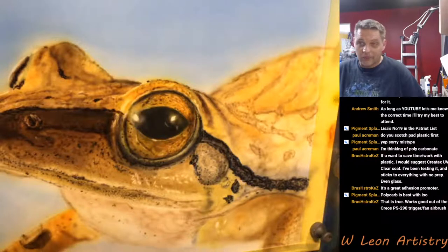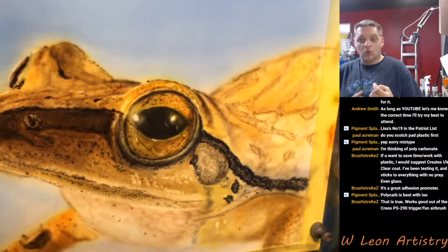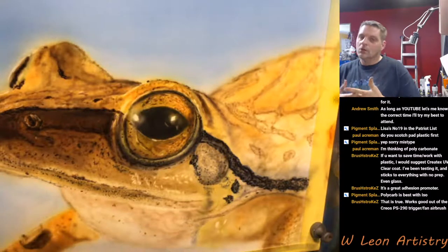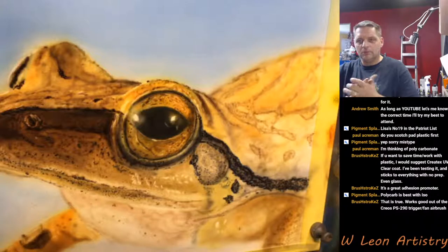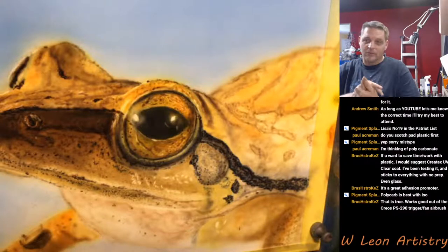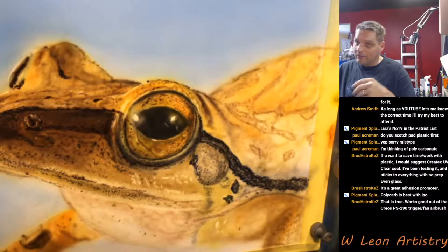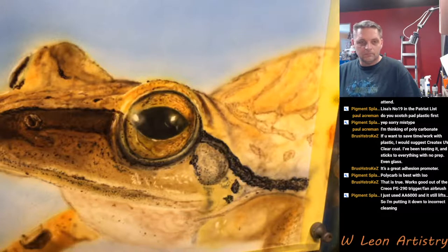For most things, like aluminum, Autoborn is great. I use transparent sealer on aluminum. Most of my plastics I use the Autoborn sealer with. There are a few things that have better solutions, but not too many things that you can't use the Autoborn for. Of course, you can't go direct to metal. The UVLS is direct to metal, but I'm really not 100% sold on that as a direct-to-metal clear. I would be a little nervous doing it on a motorcycle gas tank, because I've had a lot of gas spilled on tanks.